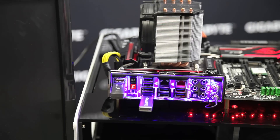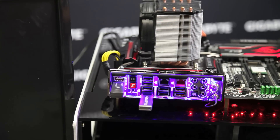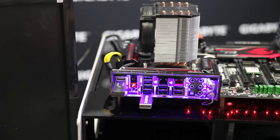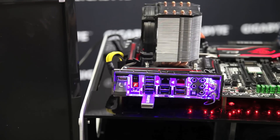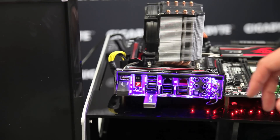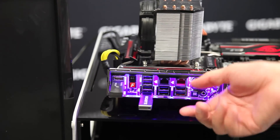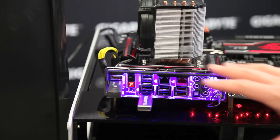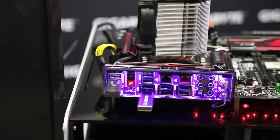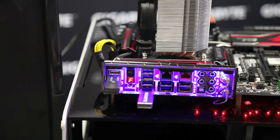So now we can see that the LED light blinking has stopped, which means our BIOS has actually been flashed. This process may take some time depending on your thumb drive speed — it's a 16 megabit BIOS so it might take a little bit of time. Don't unplug your thumb drive until you see the LED light stop blinking or actually turn off. Now it's turned off and we know that it's actually flashed.